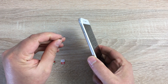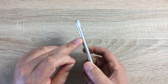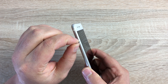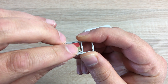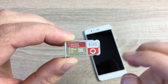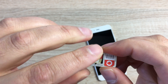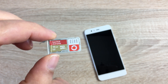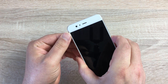Taking our phone and our SIM tool, turn your phone to the left-hand side where you'll find the slots for your SIM card and SD card. Line up your SIM tool and push straight down — you'll hear a strong click and be able to pull the tray out. With the SD card, simply line it up and it will sit in the tray. For the SIM card, you need the gold plate facing down as this is the way it goes into your device. Sit the two together and push all the way in, then power your device on.